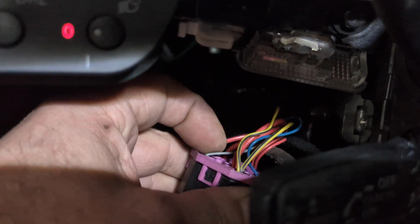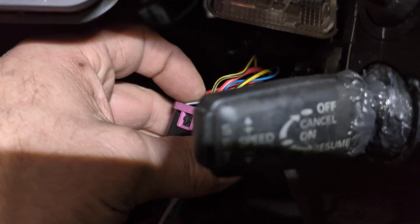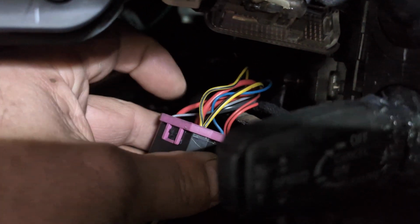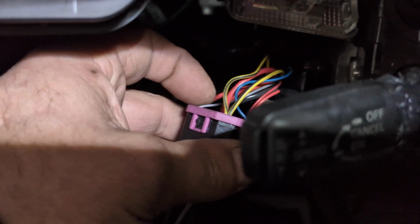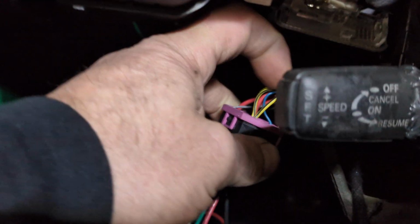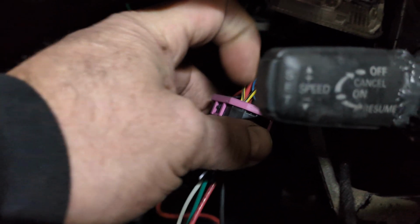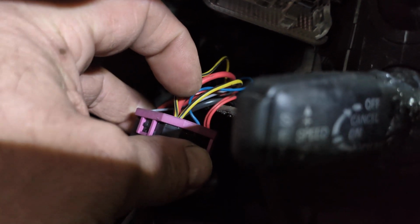There is a gray wire there. It's actually yellow and gray. This one powers the parking lights, so it's actually powered when everything is off, and as soon as you turn accessories on, it goes to 0 volt. So this one I ignored, and the blue one is the one for the stereo, and so as soon as you get accessories on, it gets powered. But I don't have a stereo in this car, so I don't care to power that one.